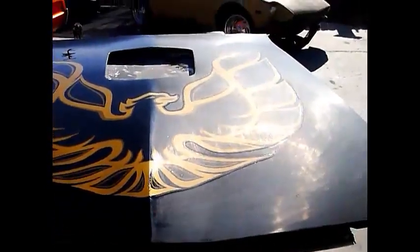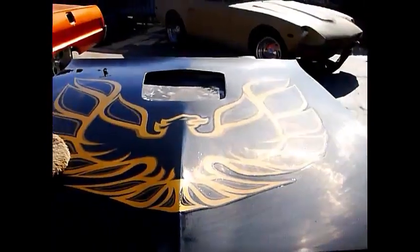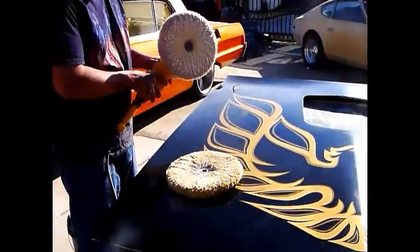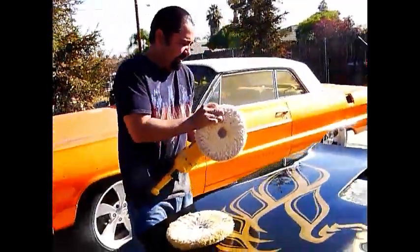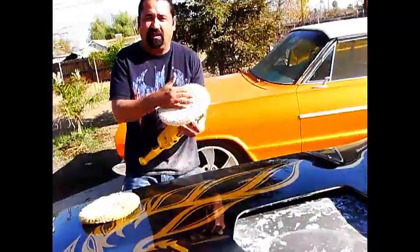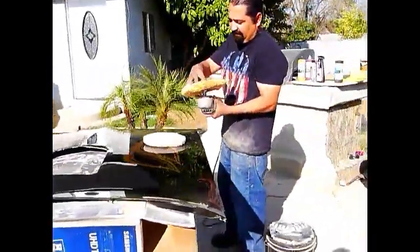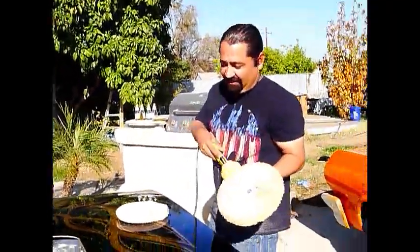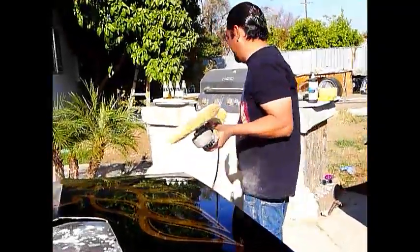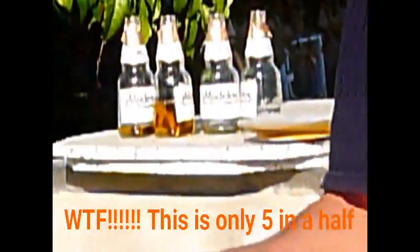That's what it should look like after your first pass. Once you get it to that stage and you get rid of most of those deep scratches, you jump over to a different pad. This is the white pad. We're gonna jump over to the yellow pad, which is a polishing pad. So just take it off, set your other pad on. Make sure that little nipple's not sticking up too much. And as you switch over with that pad, we have to also switch over with the waxes.